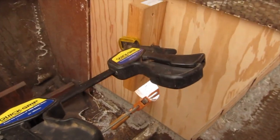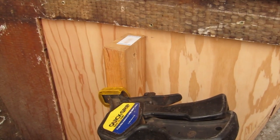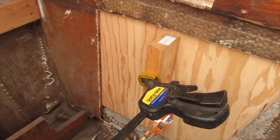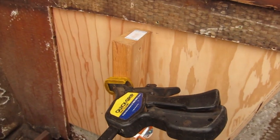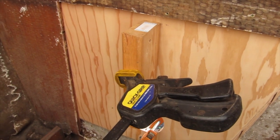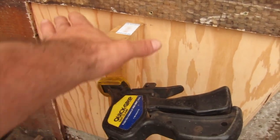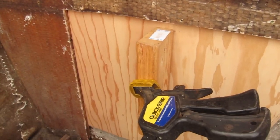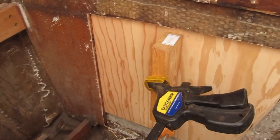Yeah. So I've got this thing clamped up by the hole down here. That's fine, but what I'm having trouble with, pardon the craziness here, is that the top is not pushing in. So I've got my clamp structure here trying to push the top middle part in. But I think because it's not pushing evenly all along this thing, I'm going to take a small piece of 1x material and cut the actual curve into it and then use that horizontally to push the whole thing in. So I'll get more even pressure all along the whole thing. Otherwise I can put multiple pieces across here, but I don't know, I'm gonna experiment a little and see what works.